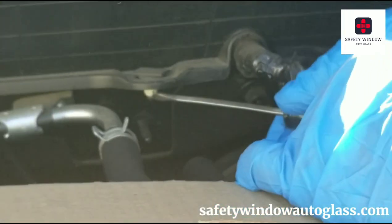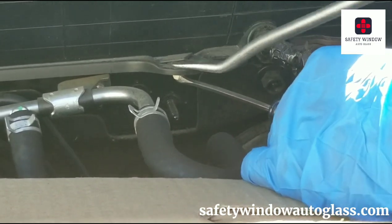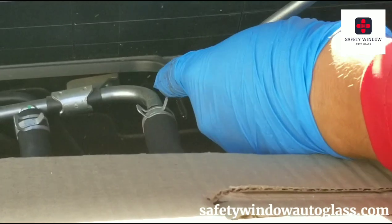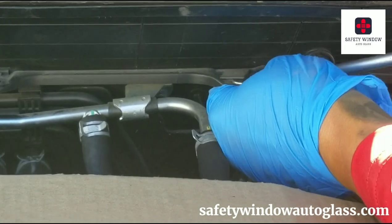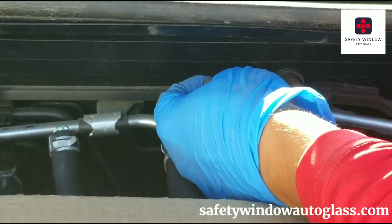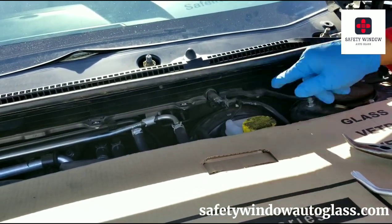That's where I'm going to come in — I'm going to stick the screwdriver in and open it up just enough, not to break it. Then I'm going to come up top and pry the clip out without damaging the cowl, just keep wiggling it. You might have to come back in and press again — it's a two-hand job for sure. There it is, just popped right out. No breakage to the clip, no breakage to the retainer, and the cowling is not damaged or scratched.